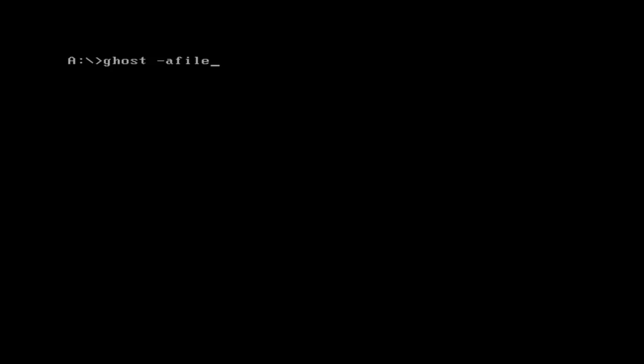I don't have any on my systems, my laptops, my desktop, anything. Odds are you probably don't on yours either. So this could be a useful command line option, and I can just specify a drive letter wherever I have a free one, C, D, E, whatever it might be. In this case, the example I'll use is C. And then whatever you want to call the file, errors.log or .txt. That'll let you specify the error log file and where to write it.